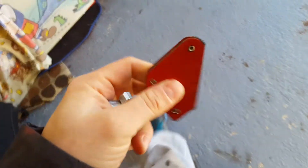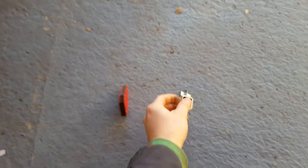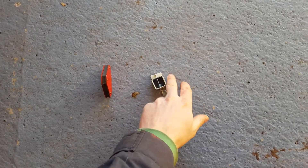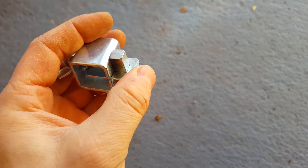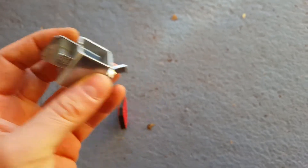What I'm going to do is stick a magnet on here to hold it in place, get my MIG welder, and just tack weld it so it's held in place. Two ways I can attach the metal until it's tack welded: first, just a magnet to hold the two sheets in place next to each other. The other is one of these wee clips — the sheet goes between there and it holds it in place. The good thing with the clips, especially with long sheets, is it leaves about a one to two millimetre gap, which is ideal for welding the two sheets together.